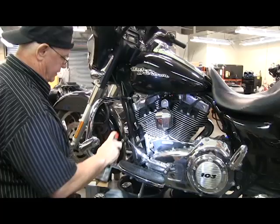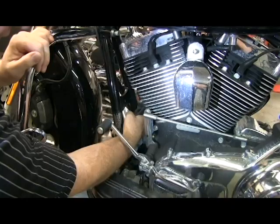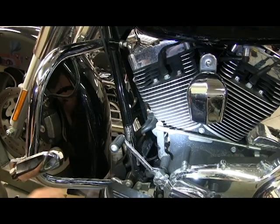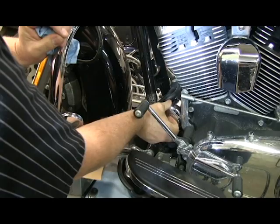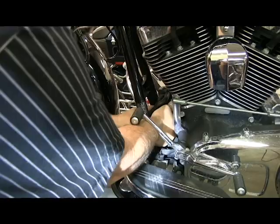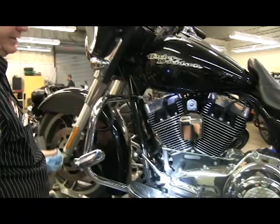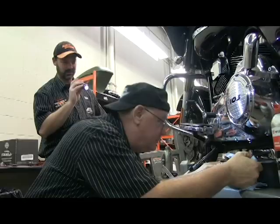Finish cleaning up the oil that spills when you take the filter off, and wipe the seating surface for the oil filter where it goes on — make sure that's wiped clean. Then take a little bit of oil, put it on the gasket surface so it's not dry, and spin the new filter back on. Hand-tighten the filter — that's usually good. Use brake clean to get the oil residue off the wires and engine parts so it doesn't continue to drip. Then reinstall the drain plug.